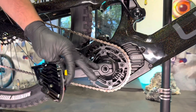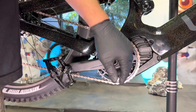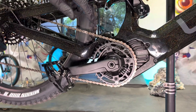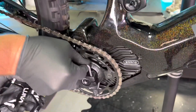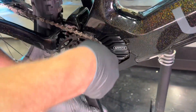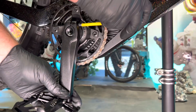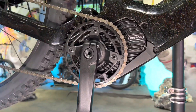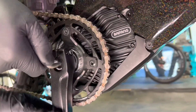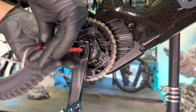So we're going to go ahead and get started on taking the old controller off of this bike. I'm going to start by removing the crank arm. You'll need a 4mm hex — you're going to want to loosen the two pinch bolts here. Then remove the main cap, which is a 6mm hex.